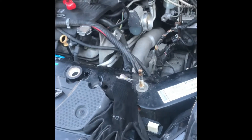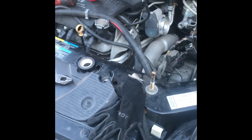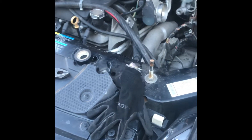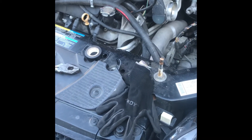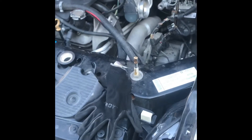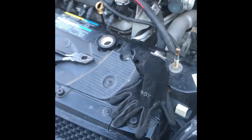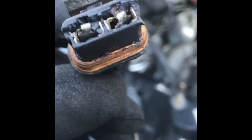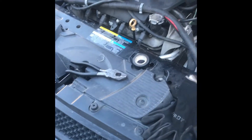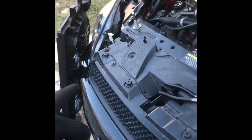This is from the YouTube customer. In the other video you'll see that part. Customer complaint was an overheating issue. We tried to burp it, tried to get all the air out — there's no air in the system at all. We discovered that the fans weren't working, the fan relays were burnt up, and also the fan harness was burnt, as you can see — crud and all that good stuff. So we wound up replacing the fans, a couple fan relays.